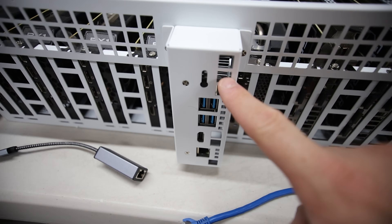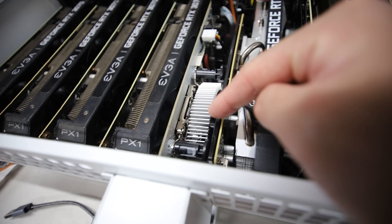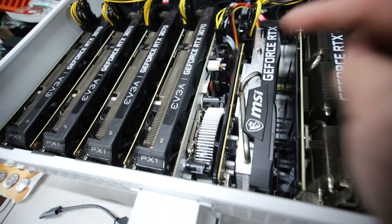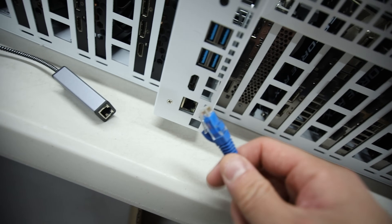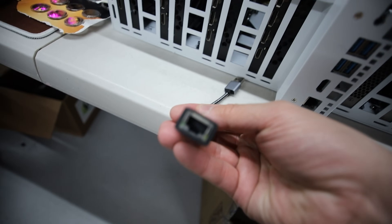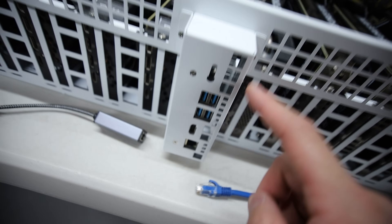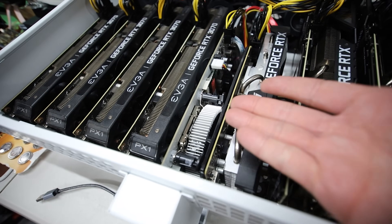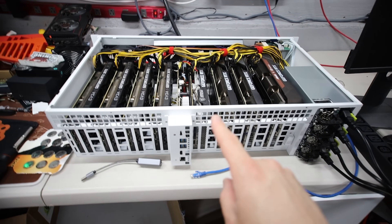The issue I'm having is I believe it's the motherboard. I'm going to try a couple of things - reseat the RAM, reseat the CPU, and maybe try adding a new CR2032 battery into the motherboard. The initial issue was the Ethernet wasn't lighting up - the motherboard wasn't lighting up. When I added a USB to Ethernet adapter it did light up on the adapter, so there is power going to it, but there are other things not working. I want to connect a monitor, USB mouse and keyboard to see what's happening. I haven't been able to troubleshoot this since I built all those rigs on the rack. So let's get into it after a word from today's sponsor.